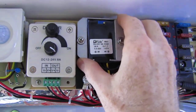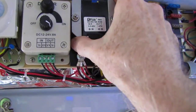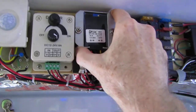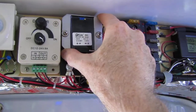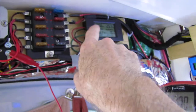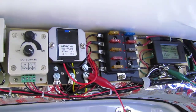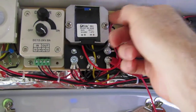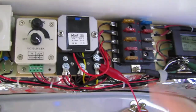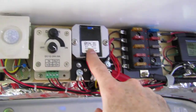This converter has aluminum fins on the back side, but you can't get to the adjustment screw if you flip it around with the fins facing out. I've been putting my fingers on it while the fan is really cranking and this thing barely gets warm. We're only converting from 14 volts down to 12, so I don't think heat will be a problem even with the fins facing in. There's no real airflow in this position, but I'll keep an eye on it — it looks like a pretty well-made unit.